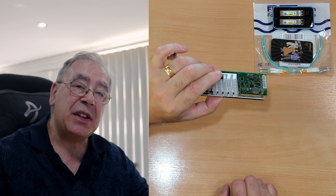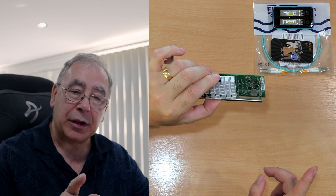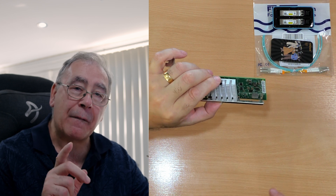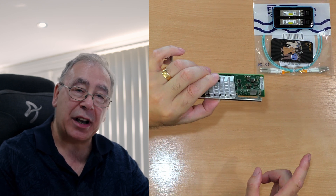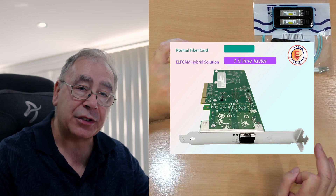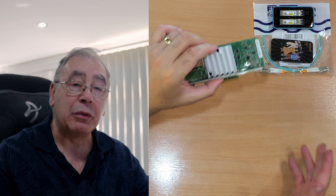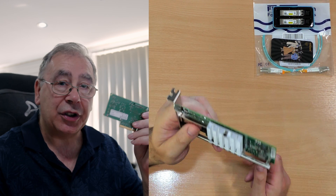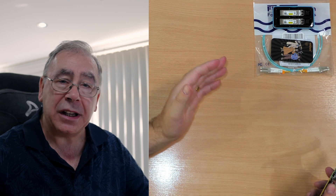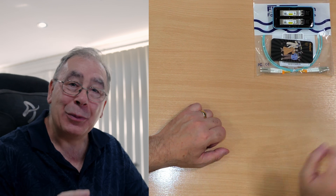You will need one of these: it's a 10 gigabit PCIe x8 LAN adapter. Something to bear in mind — if you've only got a x4 PCIe connection, don't use it because you won't get the full benefits of something like this. It will still run, it just won't get all the benefits. So you obviously need a PC — I assumed that was obvious, but you will need that.